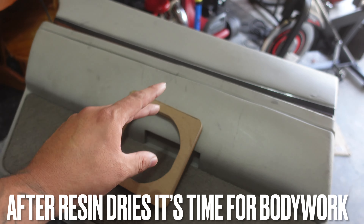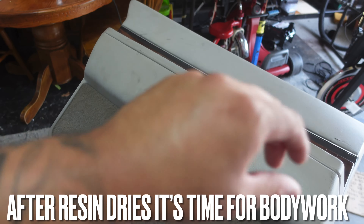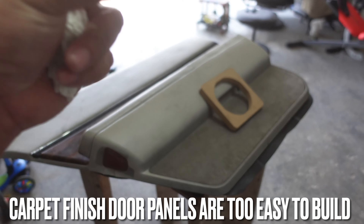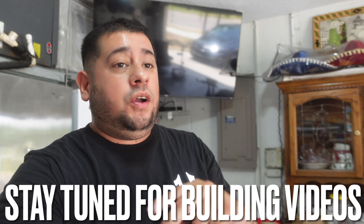Once that is done and covered with fiberglass resin, we're going to come back and sand it. Since it is getting carpet, it doesn't require a lot of sanding and Bondo — we just need to make sure there are no rough surfaces or hard dips so when we wrap it with carpet, the carpet is going to be so thick you can never even tell there's fiberglass underneath. It's going to look really, really clean. These door panels are going to be the most simplest things you guys could possibly build — fiberglass and carpet, it's a walk in the park. If you're doing door panels to be fiberglass painted or wrapped in vinyl, yes you do have to go into detail with sanding, Bondo, and all that, and it's going to take a lot more time. But with carpet it should take probably just one day to sand and wrap. Definitely stay tuned for the next video — hit that subscribe button, hit that like, and I'll see you. Don't forget, watch the videos.